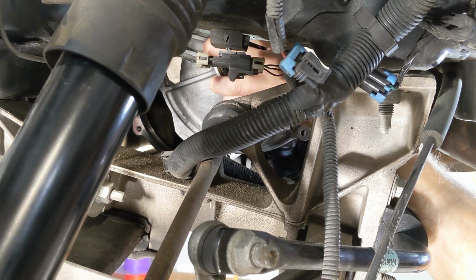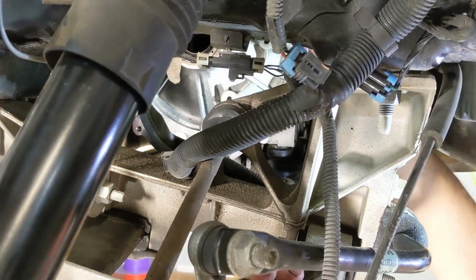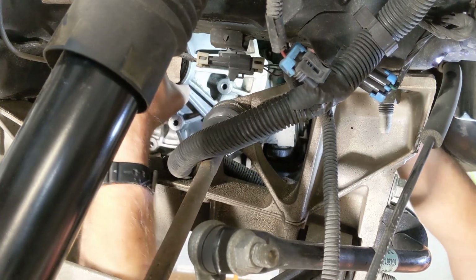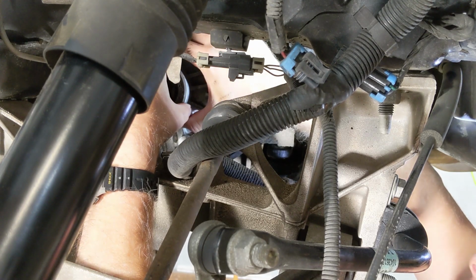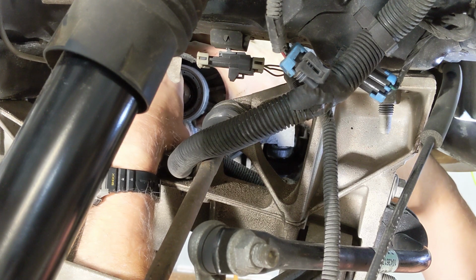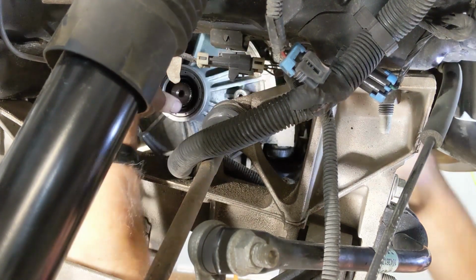Otherwise, continue to proceed to move it into position. Align it with the dowel pin sticking out of the transmission. Make sure that's aligned properly, and carefully move the cover in towards the differential because you don't want to have to twist it at all, and then slide it in as far as you can get it by hand.